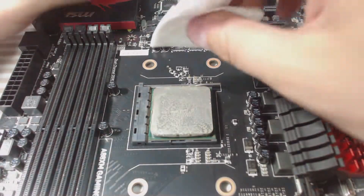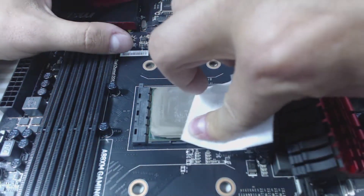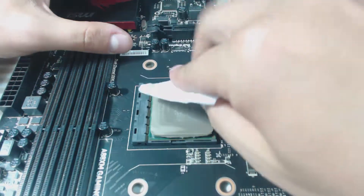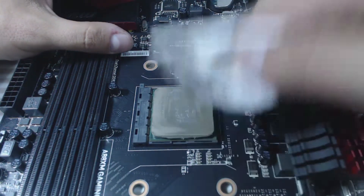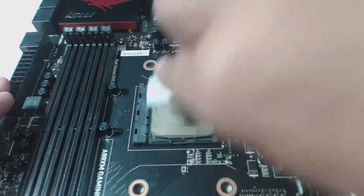I've chosen to leave my APU inside the motherboard because bending the pins terrifies me. So what I'm going to do is just clean around the edges, flip the paper, and continue cleaning until the paper is either soiled or I feel like it's not cleaning well enough.